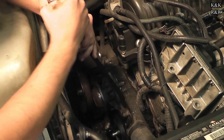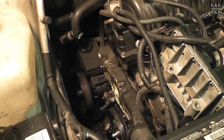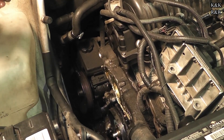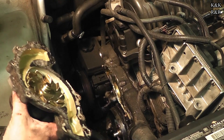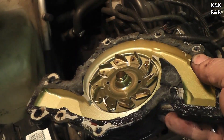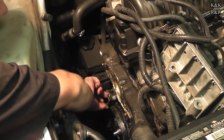They're better off using a rubber mallet. It's really hard to find the impeller style — that's what the aftermarket gives you. At this point you want to give it about 5–15 minutes to drain out before going further; let as much coolant out as you possibly can. I want to show you what lack of service does to a water pump — this has been changed once and look how green it is. That's because the coolant wasn't changed regularly.